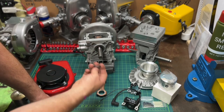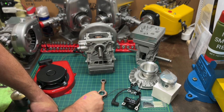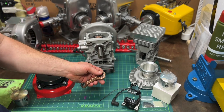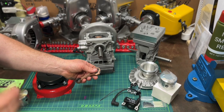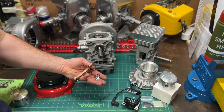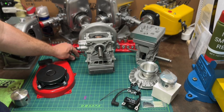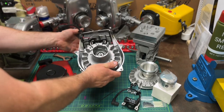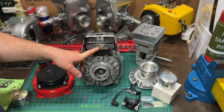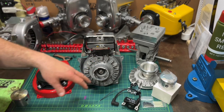One of the differences with this one is you're going to have the caged bearings. I've measured these, I've done a video on it on YouTube — they're built to the exact specs within the Chrysler manual. They've been tested up to 9,000 RPMs. So just buying this engine as-is, you can take it to the track, put it on your cart, and take it up to the limit of the 9,000 RPM PVL digital programmed coil without worrying about the rod, bearings, or piston.